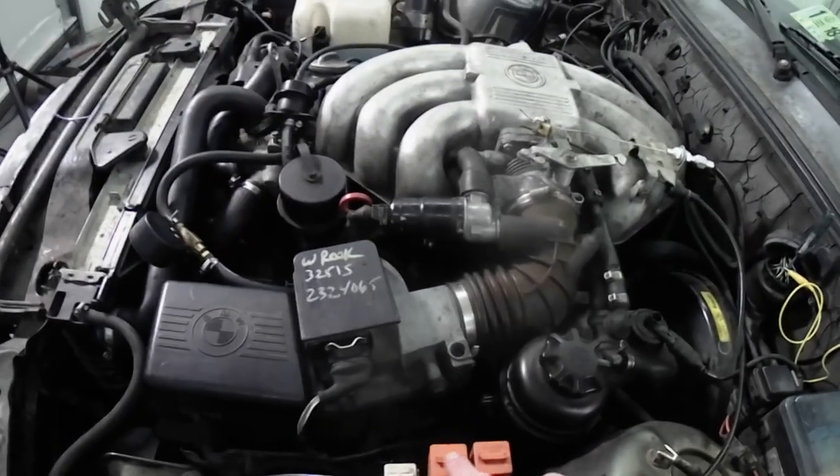You've checked this relay, maybe replaced it. More than likely, the crank position sensor is bad, okay? Now, we can also double check that, you can double check this relay. There's ways to jump the relay. We're not gonna get into every little situation because it really is endless. More than likely, the problem is your crank position sensor if you don't have 12 volts back to the pump at all, okay?